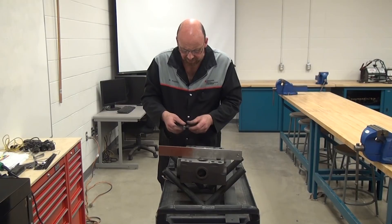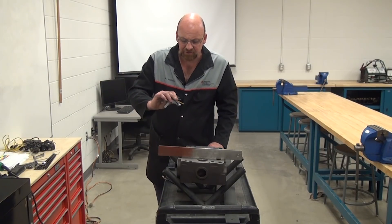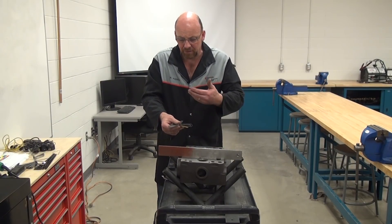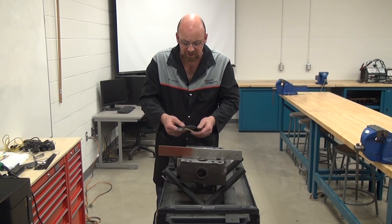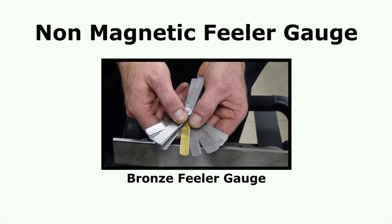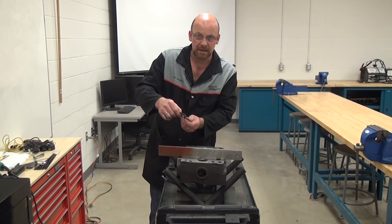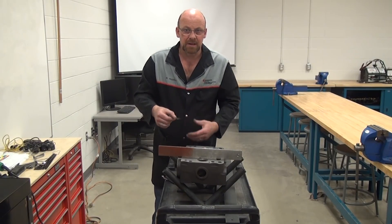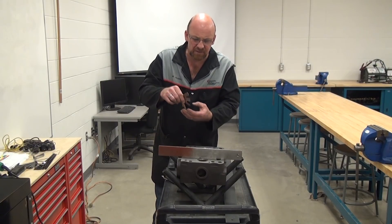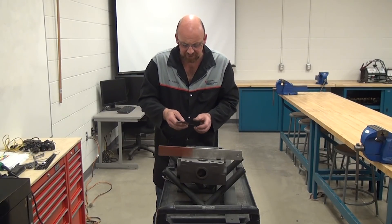Picking up another set of feeler gauges — I just noticed this different colored one in here. It's a bronze feeler gauge included in this gauge set. We talked about buying different gauge sets: over length, angle, no-go gauges, straight cut gauges. This one in particular includes what's called a non-magnetic feeler strip, and that is used for setting older electronic ignition systems between the reluctor and the magnetic pulse generator. That way you don't go in with a steel gauge that is magnetic, because that can change the polarization of the pickup and you're not feeling the drag correctly.